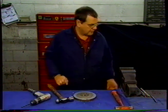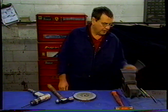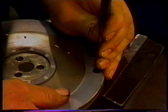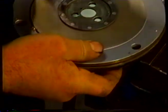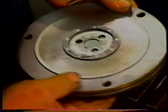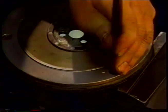When we've done that, we'll go to the vise and we'll tap them through, but we'll support the finger as best we can so that the pressure is only on the rivet. Take a taper punch. All the time keeping the support on the finger, because you'll bend it off or break it. I'll explain that to you when we get the plate off.